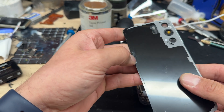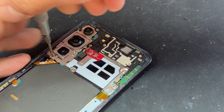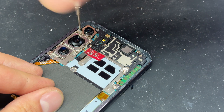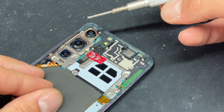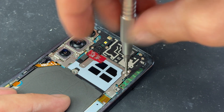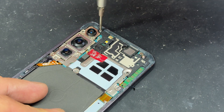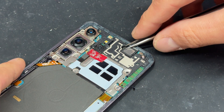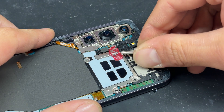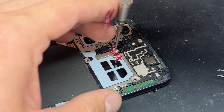Now that we're into the device, I think that's an aftermarket part, to be honest. We're going to take a crosshead screwdriver and remove all the screws holding down the shields at the top half of the phone. Just take note if there are any different sizes, like this black one in the top left corner. I believe there are 11 in total on this one. Some of them will come off with the magnetic screwdriver, and we'll use tweezers to capture the ones that got left behind.